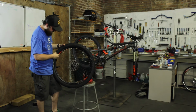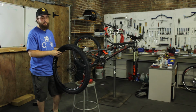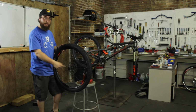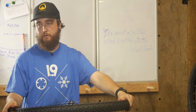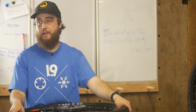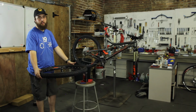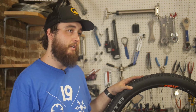The valve leakage sounds like it stopped, but if you're having a problem seating your tires, what we recommend doing, if you know that they are tight on the actual rim bed, sit them on a trash can for an hour or so and let the sealant distribute all around the actual tire and rim interface, and then in another hour to 2 hours, flip the tire and do the exact same thing. Having the wheel and tire laid horizontally will help distribute the sealant and prevent any leakage that may still be occurring.